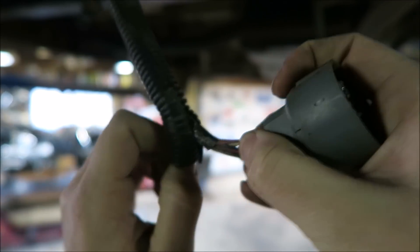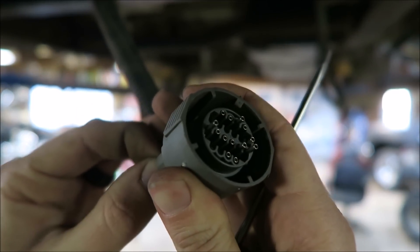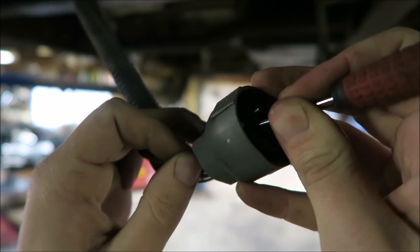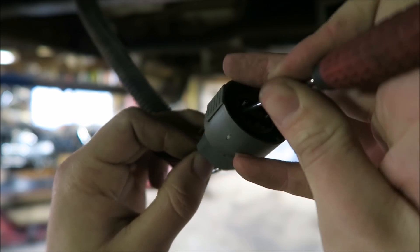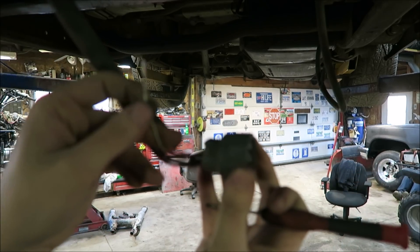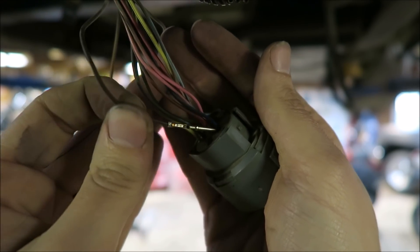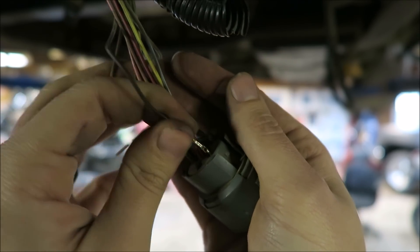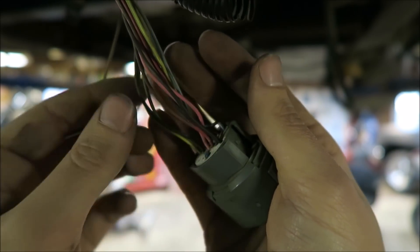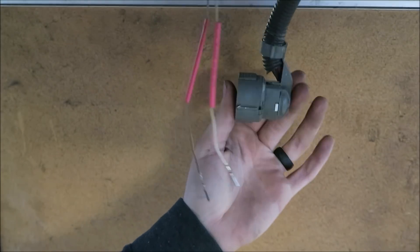The white wire and the tan-and-black wire we're removing, and then the brown wire we're moving to the slot where the white wire was. This white one here is the first one we're going to deal with — we'll push it up and go in there with a flat blade to pry that little tab out of the way. There's the white wire — that one's out of the way. Then once you have all the wires out, you just move the brown wire from where it was down here to where the white wire was up here, just pushing it in like that. You should use some silicone to seal this up just to be extra safe.